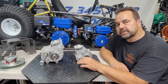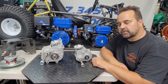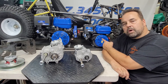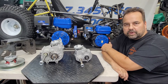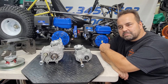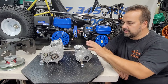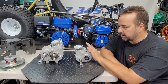The 30-series uses the 30-series CVT clutch belt drive, and the output shaft is 5/8 of an inch. So if you have a 212 Predator-type engine — basically anything that looks like this — these engines come in 196cc and now up to 240cc. You can buy your 212 Predator at Harbor Freight for around $100 US, or at Princess Auto in Canada for around $150 Canadian. This gearbox weighs about seven pounds and is what the 212 power pack bracket is designed for.